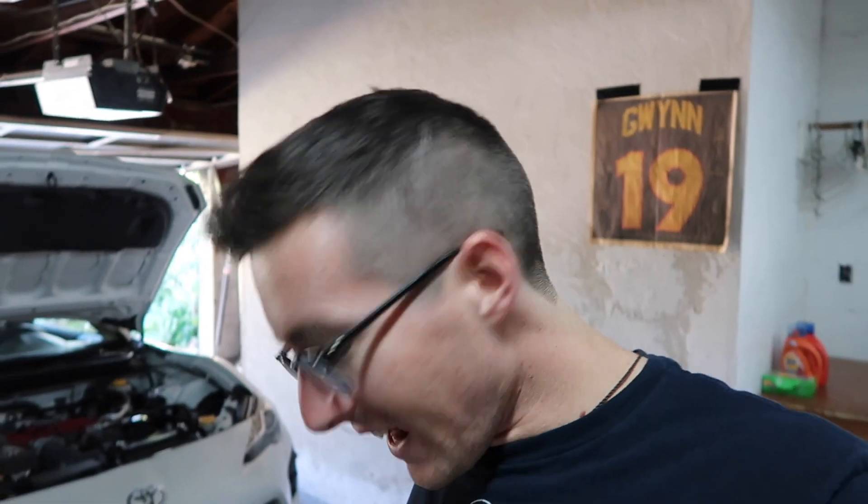What's going on everybody, today I decided to take another crack at fixing the 86. I emailed a couple people and it turns out that because these are inverted monotubes, like I said in my last video, they do need to be regreased periodically because it's a race car part. This is a PSA: if you're thinking about getting inverted monotubes, think twice. Not all are created equal. These White Line, aka AST coilovers, are known and notorious for running out of grease early and they'll ruin the bushings if you don't catch it in time, essentially requiring a rebuild once a season, which is crazy. I can't say I would recommend these unless you're willing to take them apart and regrease them.